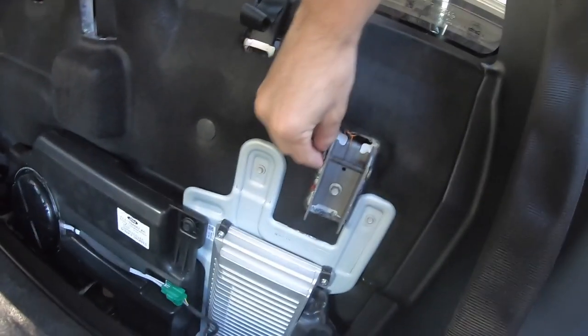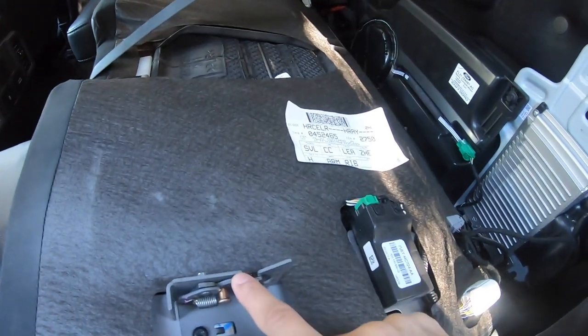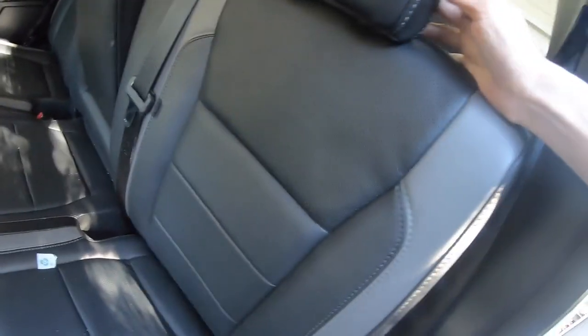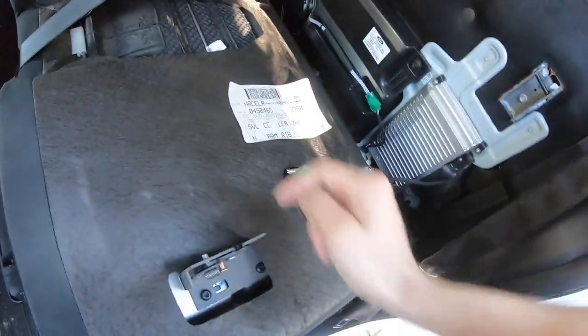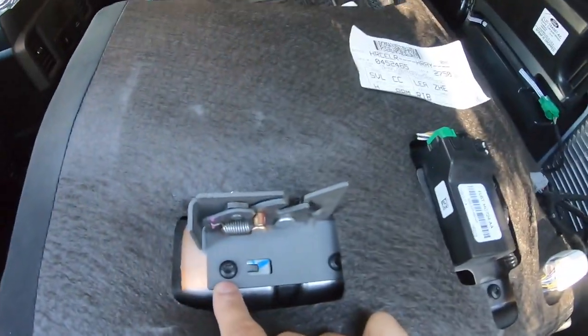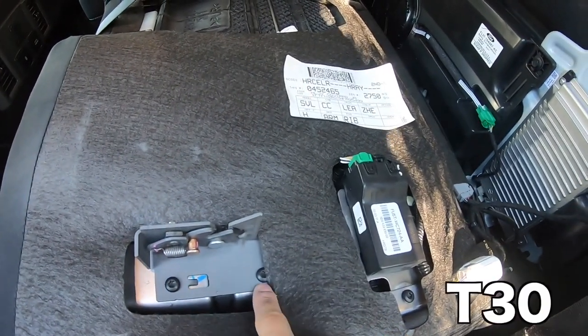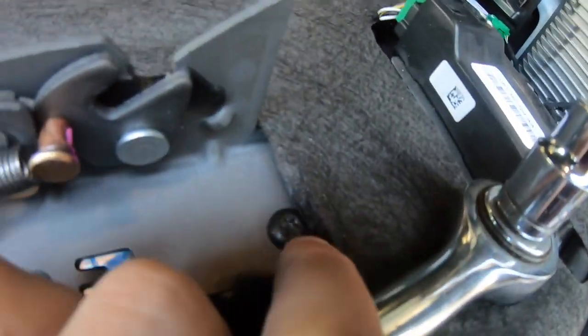Remember to fold up the seats before you do this so you have room back here. You're going to feel that little latch — it's the loose one right here — and you simply just pull up like so, and then this releases the little thing that allows the seat to fold down. Pro tip: fold down your headrest when you have it up to give you more room. Once you have this thing down, let's go ahead and install the bracket. We need a T30 bit — that's the size you need to remove these screws.